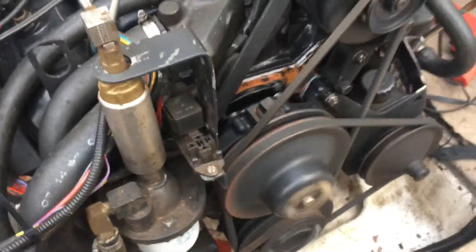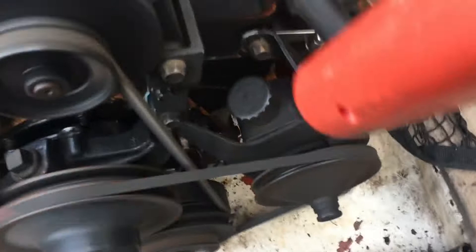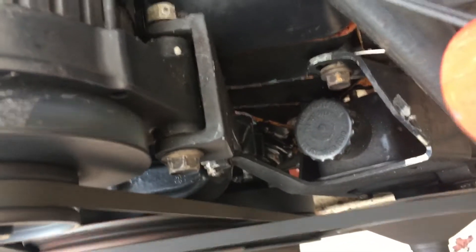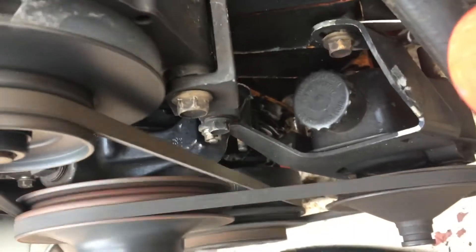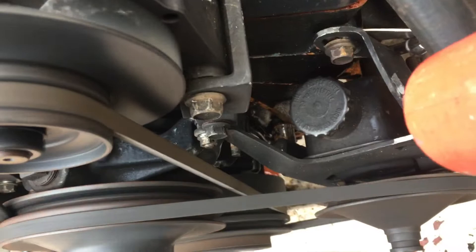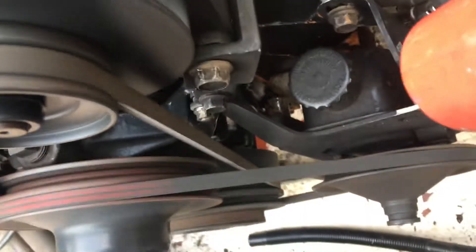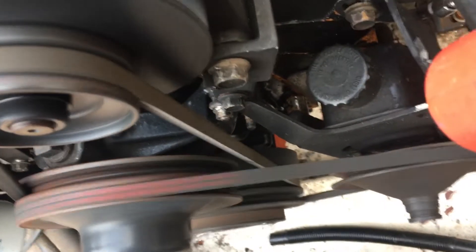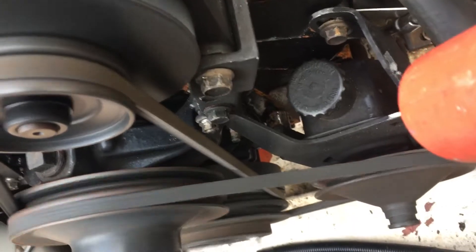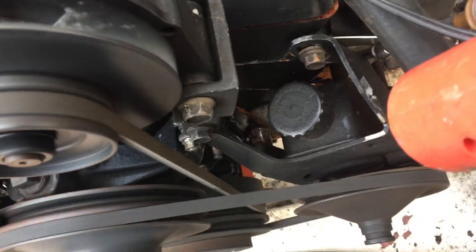As you saw, the engine slowed down. And with a timing light, if I shoot the marks right down there — the timing mark lines up with a notch on the cover of the timing chain. So this one is right on the money. It's one degree before top dead center, which for my engine looks like right on the money. So this distributor is dynamically timed, and if I rev the engine that timing won't change.